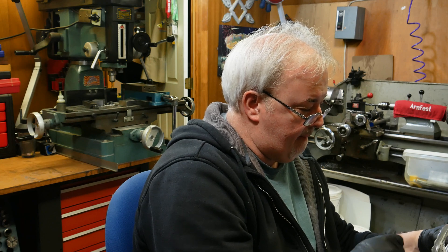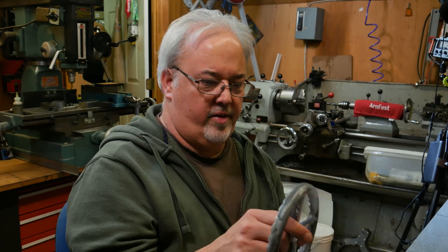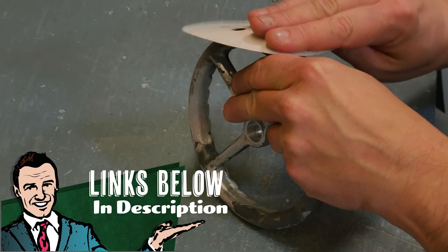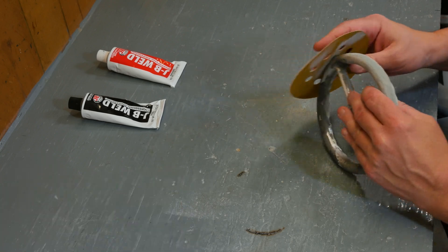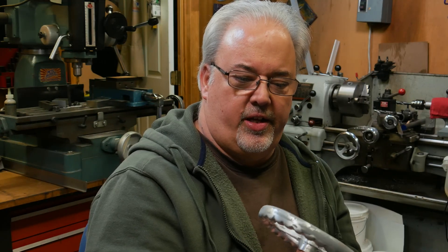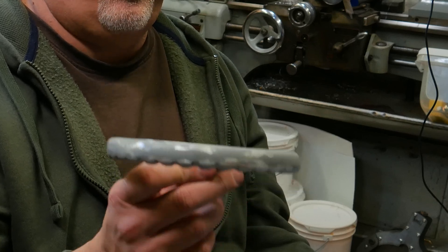Alright, I'm pretty happy with that. This has been setting up overnight and I'm going to sand it down. So I've got the steering wheel sanded out, then I took it inside and washed it with detergent. Next step is to degas it — we're just going to put it in the oven for about 40 minutes or so at 400 degrees and bake it to drive out any impurities that might be in the surface.